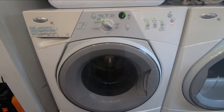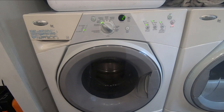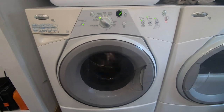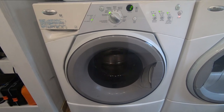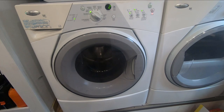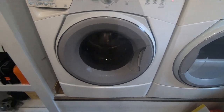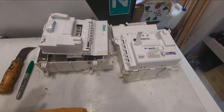If you end up with an F28 code on a Whirlpool washing machine, unplug it and wiggle all the connectors on the different boards — there's one up here, a motor control board down below, and one under the top panel. If that doesn't fix it, you may need to change a board. Another good idea if you've got an older washing machine you want to keep going: look for a secondhand identical one, strip out the parts you need — they don't take up much room in a little box in storage, and they're good for next time.